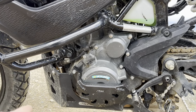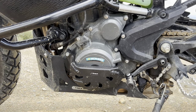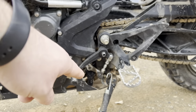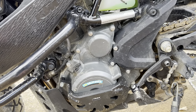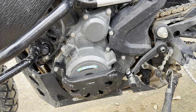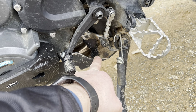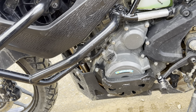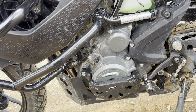I really like their skid plates — I've got one on my other bike, the Svartpilen. The only thing is I still need to do some adjustment. First time I put it on I had to kind of squeeze fit it, and that mount back here — the factory one broke shortly thereafter because I probably had it bolted down tight and it was pulling and twisting on itself, which ended up fracturing that factory mount. I got a new one now, but I'll have to drill out a hole and put a spacer in to secure that end. For now it's got three mounting points and as long as I don't go flat landing on anything I think I'll be okay.